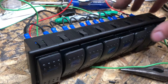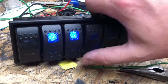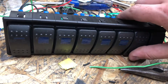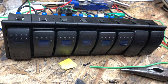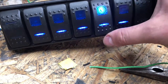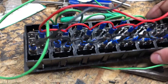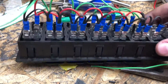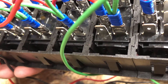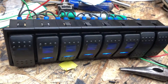Okay, so this is what it looks like normally. Here are your switches — they light up when you press them. And then these ones don't have power yet because there's nothing coming from the window thing yet. But when you have illumination from the headlights, you get these that just kind of glow and then they activate the top, which is really slick. So the red is the power, black is ground, and that green is the illumination from the headlights. And then all those other extra pins that don't have a spade on these guys, and then the one opposite — those are the outputs to the relays. I'll pick this up tomorrow.